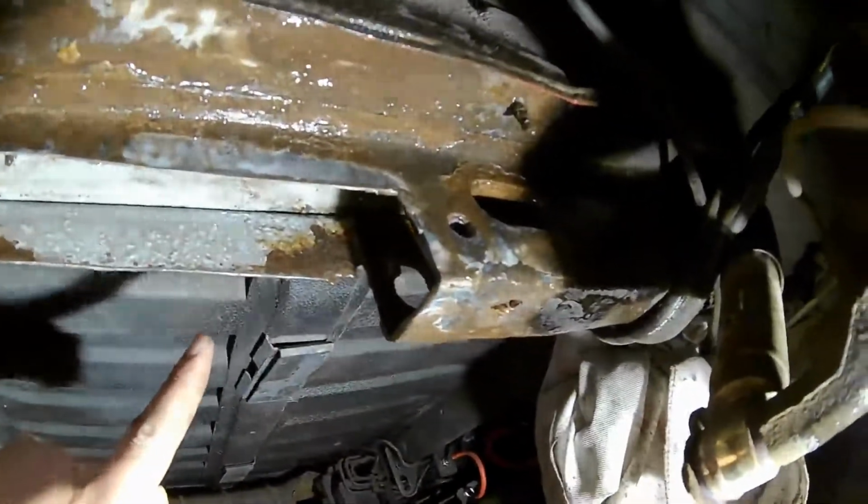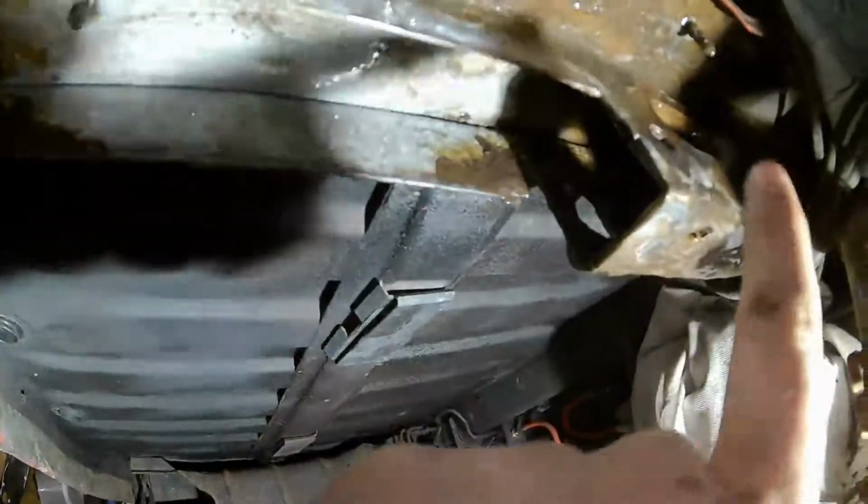It's just sort of turning it a brown colour really. I don't know if it's just taking off the surface initial crud, but it seems to be working really well. I did take an angle grinder to most of this to get rid of the majority of it. There was quite a heavy underseal on the bottom of this car, almost like a really thick bed liner underneath the car, that came off in these weird large chunks.